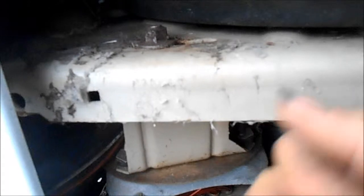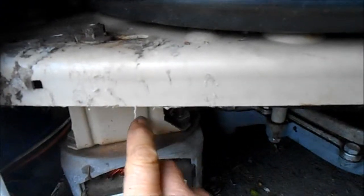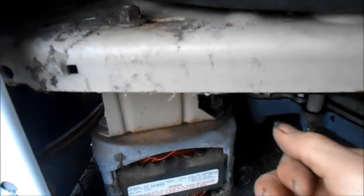This is the bolt for the belt tension. Basically, in order to put tension on the belt you need to loosen that — it's a regular right-handed thread. Loosen it slightly and then put your wrench back on it and tap on this as you tighten that, because as you tighten it tends to loosen up. So loosen it and tap on this as you are tightening this bolt, and that will hold the tension.